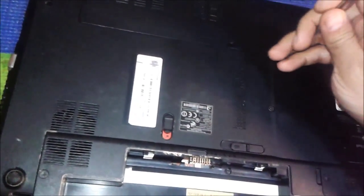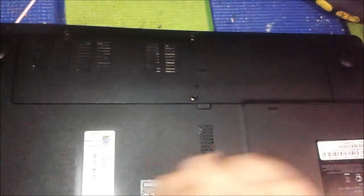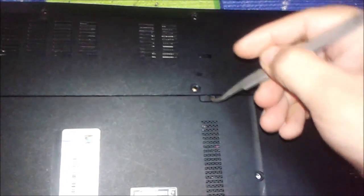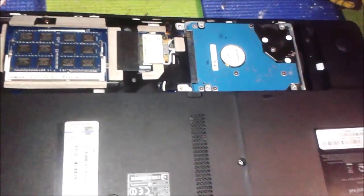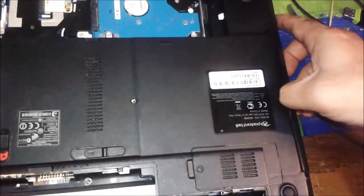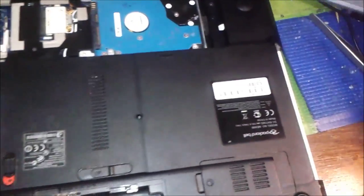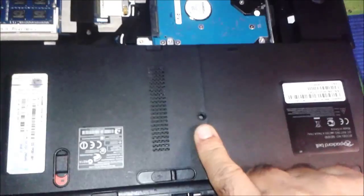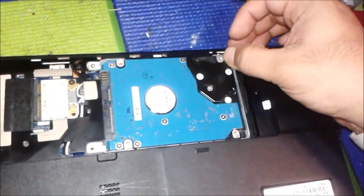All the screws I've opened already. Now, for all computers whenever you want to open them, there are some small edges on the casing — you put a screwdriver in here, pull up, and you can remove the cover on top. This model sometimes shares the same body and casing with Acer models and some Packard Bell models. This is the CD drive that I just removed, and this is the hard drive screw holding it to the casing.